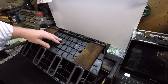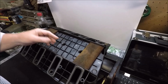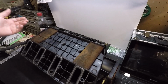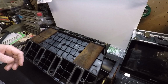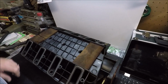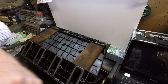Removing these ridges from the floor of this intake is not going to do anything. It's going to gain you, what, a quarter of an inch of clearance at most. I mean, it's pointless, guys. Now, I've heard the argument that if you're running a 4-corner steam port system, you need clearance. Okay, well, that's fine. Lay your steam lines on here and cut some notches where they go, where they'll lay. Don't just smooth out the whole floor.